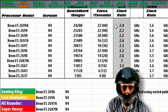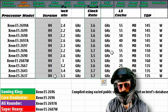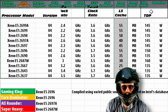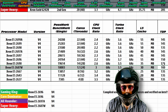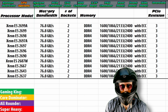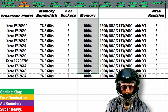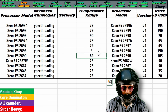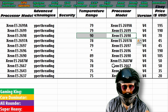We have the Turbo Clock Rate for each one, the L3 Cache, and how much memory is on each CPU. We also have the total power that each CPU may pull — very useful when planning your build — as well as the bus speed, total amount of memory, and memory bandwidth. These particular Broadwell ones support 1600 up to 2400 MHz. I even included the temperature range so we know what range the chosen CPU can sustain.